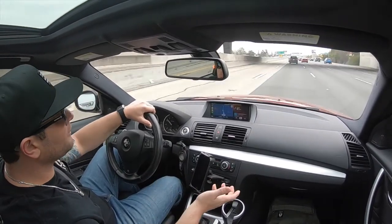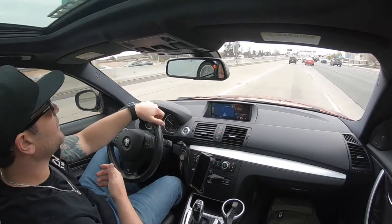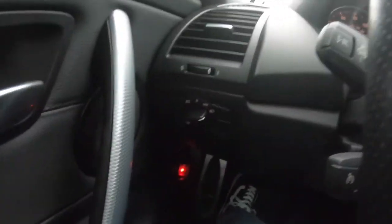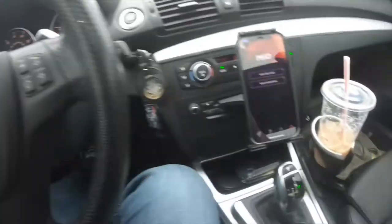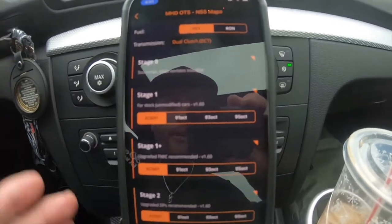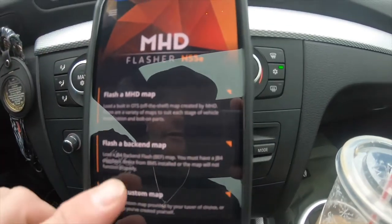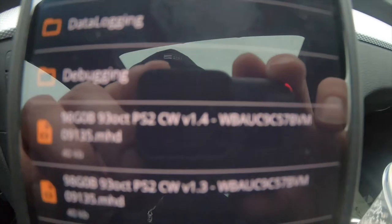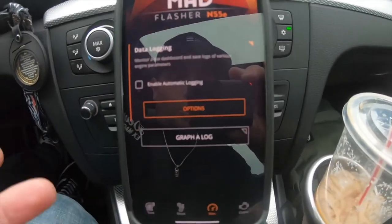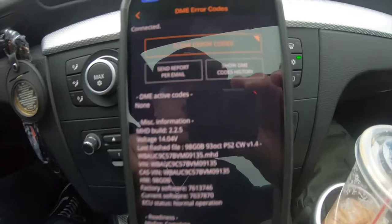All the tunes are uploaded as a flash tune through the DME using MHD. I also have an XHP transmission tune, which is probably the newest tune on this car — honestly I should have gotten it sooner, it just makes it a pleasure to drive. Here's the MHD wireless dongle that plugs into the OBD2 port — this is how you load tunes onto the car. You can see the flash option and the MHD map. I have all the over-the-shelf tunes that come with MHD, but I don't use those — I use the custom tune I was mentioning, and here you can see all the custom tune versions.